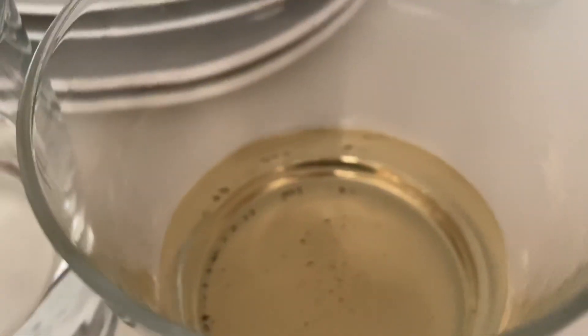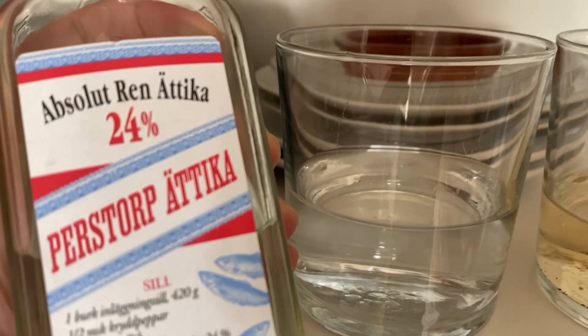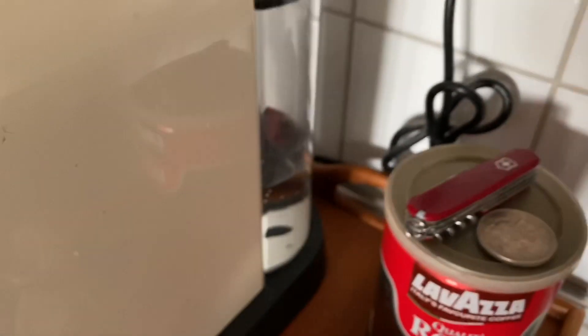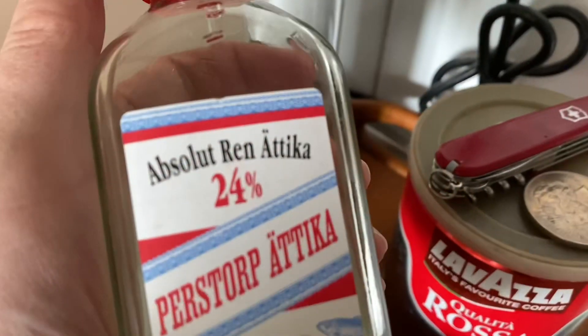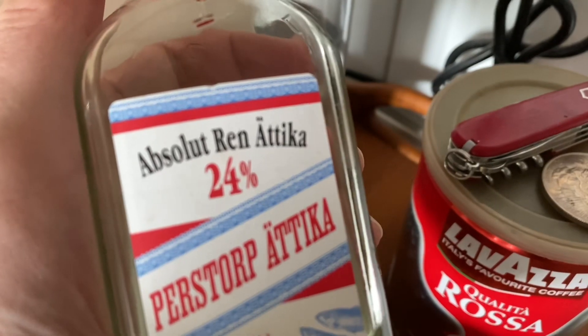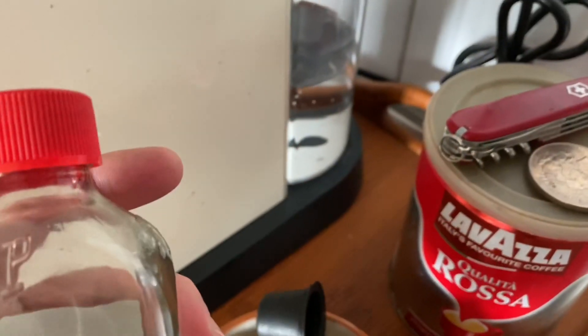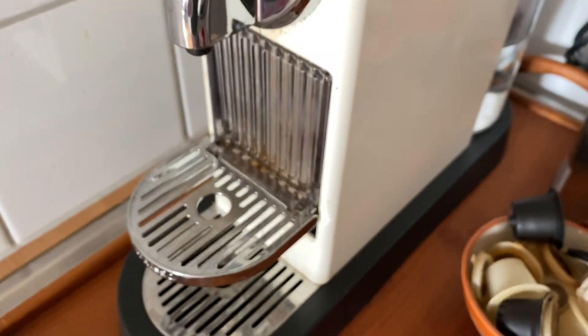Acetic acid does dissolve inorganic oxides and the type of oxidation products you get inside copper or brass tubings found inside the coffee machine. We're going to push it through the machine in the same way as we pushed the water through. I'm going to start by filling up to about 12% concentration, and if that's not enough we will run the 24% concentrated version. We'll let it sit in the tubings and then compare what we get out.